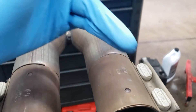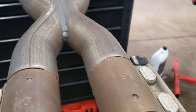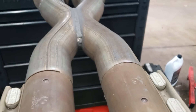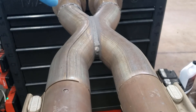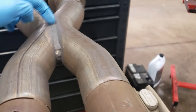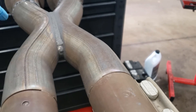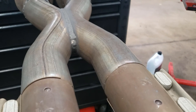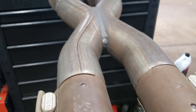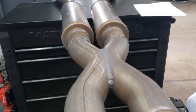It makes it easier for bank two to pull air in if bank one is causing a vacuum in here, and vice versa. For example, on an inline six where the firing order is 1-5-3-6-2-4, each cylinder firing is gonna be right behind each other and help pull the exhaust through. So the more RPM, the better the airflow, and the more power you're gonna essentially make.